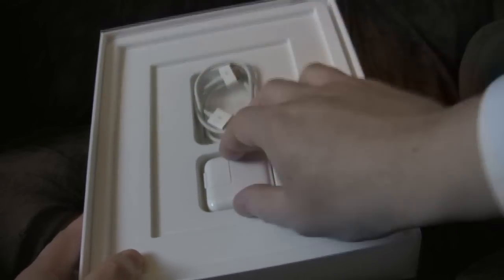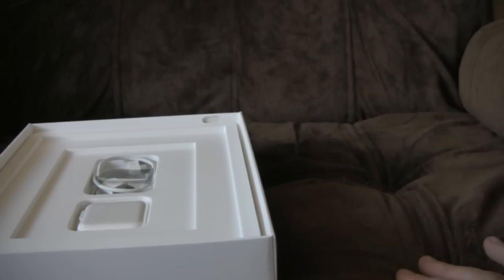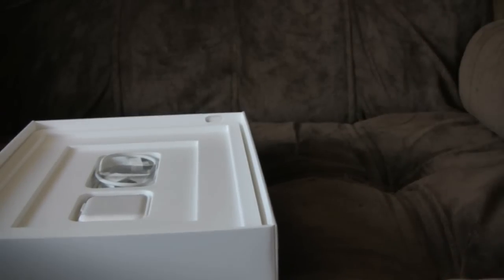You have a USB lead and a power adapter, which is of course no use to me at all because it's an American one. Something you should bear in mind if you happen to be importing one is that it won't charge off a standard USB socket. The quite big battery takes an awful lot of juice. If you just plug it into your Mac or PC, the iPad says rather petulantly, NOT CHARGING. Your best bet is a proper USB adapter. The one that comes with the iPhone 3G does work, but it gets bloody hot.